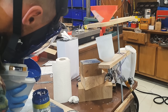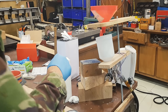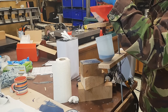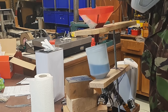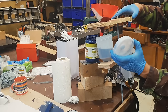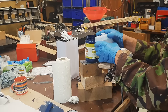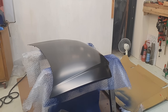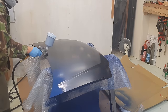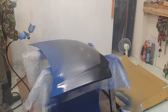So here I am preparing some more paint. I'm just mixing in a touch of water to dilute it, which is a cool thing about water-based paints. This gives it a consistency that will just about go through the tea bag strainer thing I'm using and seems to go through the gun well. Now, if A, you've got experience with water-based paints, and B, you're a professional spray painter, and C, you haven't destroyed your computer in frustration yet, you could leave us a comment below saying what I should be doing to mix up these paints well, and I'm sure that'd be useful for our DIY watchers here as well.